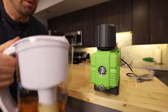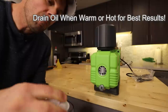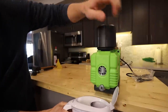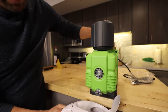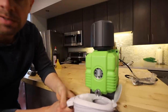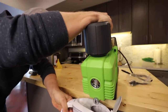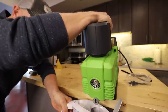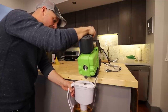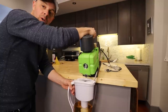The first thing we want to do is get rid of any oil inside the pump. If you don't have a premier pump, most are pretty similar and will have some kind of drain plug. This pump I'm using today is actually my backup and it's brand new — I need to drain the oil out anyway because it just sits. Once you're done draining, I like to tip it forward just to get all the remaining oil out, because if you don't, it's going to end up on your floor when you pull the front cover off.